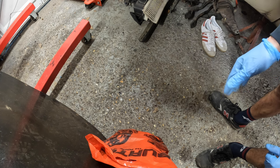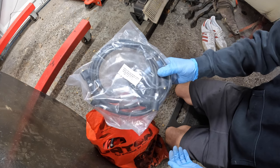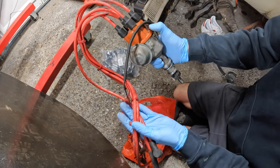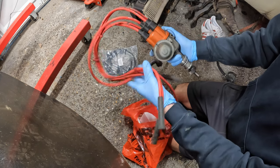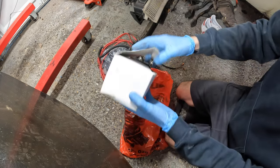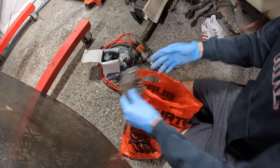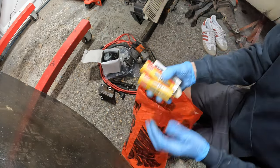Let's take a brief look at what I've got in the bag of bits. Some parts are new from Burton Power purchased a couple of months ago and some are other bits I need to fix the engine. I've got some new ignition leads, a distributor that came with the Pinto — converted to electronic ignition, just the leads are a bit naff and one end has come off — so I've opted for new black ones. There's the fuel pump, a new oil filter, the alternator bracket that needs a lick of paint, the alternator adjuster, and four new spark plugs.